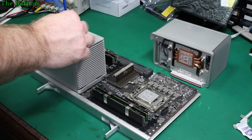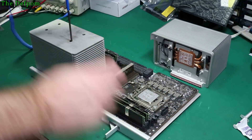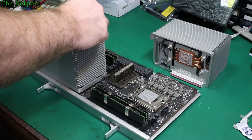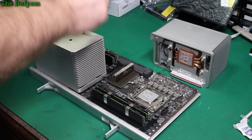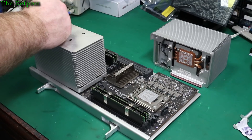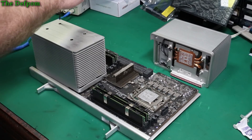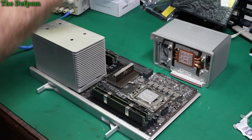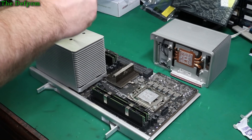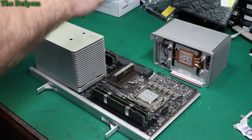Get onto the screw. There's a bit of fluff in there as well — that sort of stuff has got to come out. It's not too bad under there, but you've got captive screws. You have to undo them a little bit at a time, otherwise they'll go a bit wonky. Technically you should go diagonally all the time, but for tightening it's very important — less so for loosening. Just trying to keep them even. They are sprung and captive at the same time.